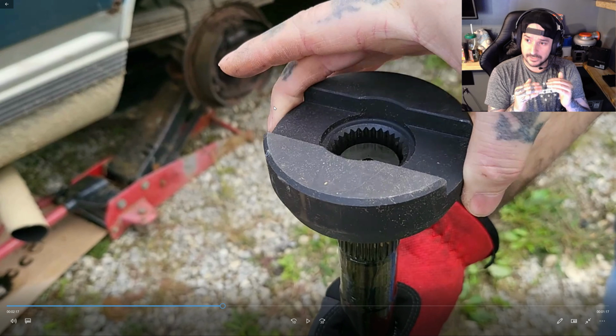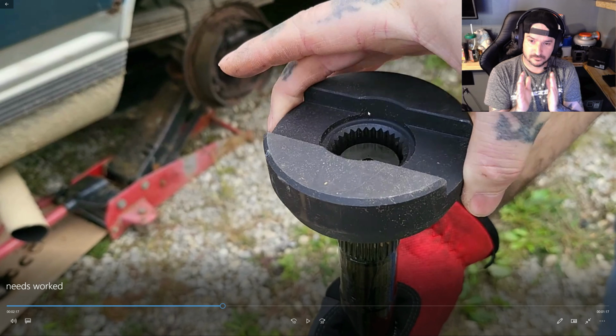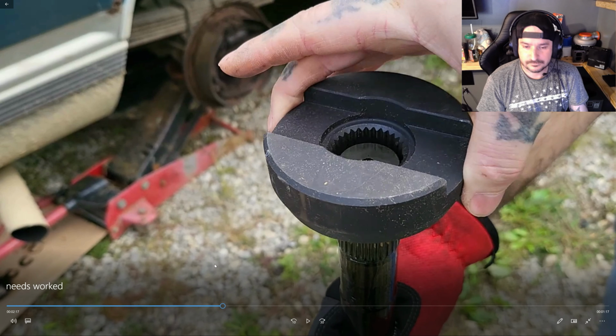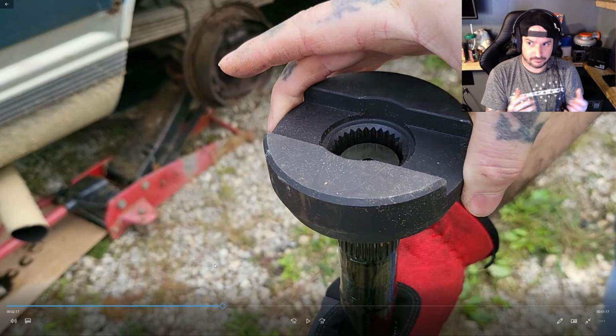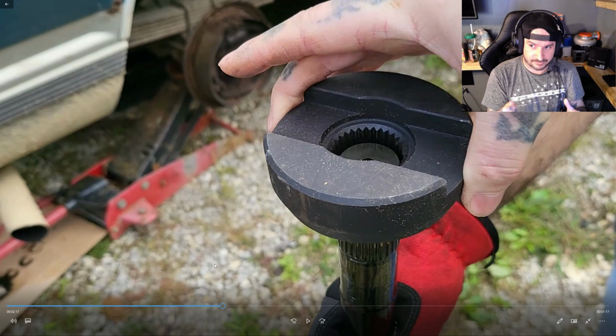But your squares go together and they fit, and your pin keeps the axle mashed in where your C-clip sets here. Now those little pieces will cover some of the C-clips and mash up against your axle. They don't fit perfect. So sometimes what you have to do is shave the flat part off that goes against your axle to get them to rotate in place, and take a little bit off at a time. Sometimes they fit perfect. This one didn't fit perfect. This one had to have an eighth shaved off of each one. That's how bad off it was.